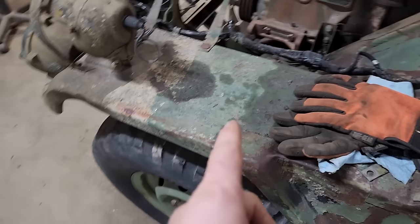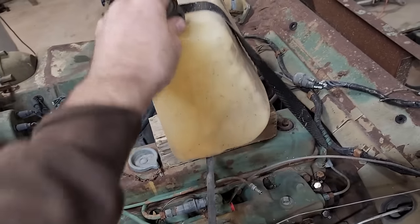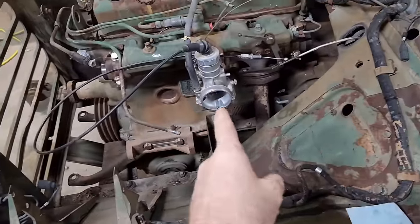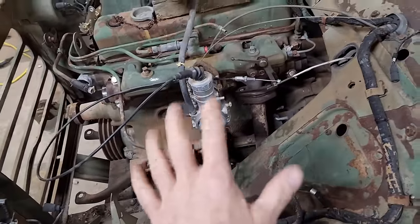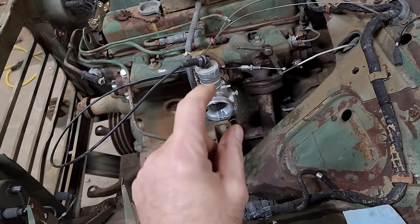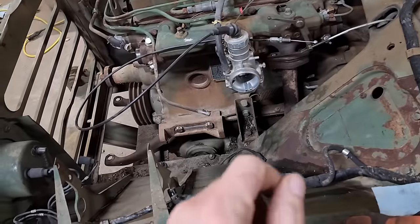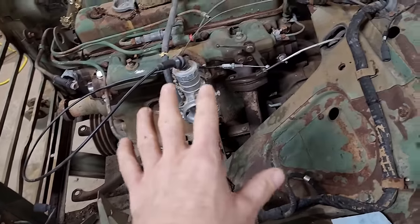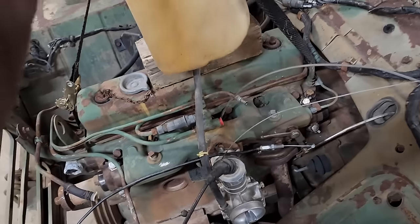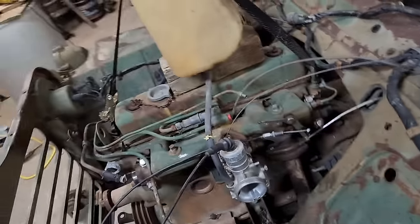All right, I got the axle shaft back on. Did this fine gravity feed setup here. And as I mentioned, the carburetor seat and needle had the right diameter. The overall height seemed pretty good. It's just the hold down mechanism. I had to make a spacer and a longer screw for that. So hopefully that will work now with the gravity feed there. Yeah, that's definitely wobbly, but I'm only going to put very little fuel in it anyway when the time comes.